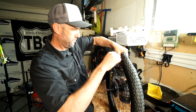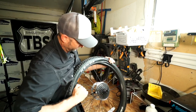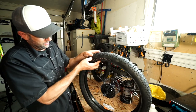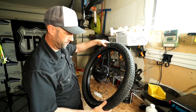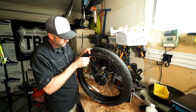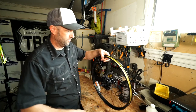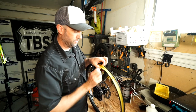You want to take a tire lever, lever the bead off, open it up, find your valve stem, and pull out the tube. It's pretty heavy. You want to take the tire all the way off. Now it's going to have some sort of a rim strip on it already, and you can just remove that.